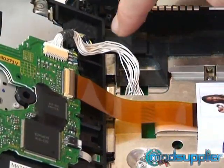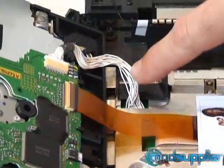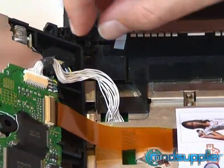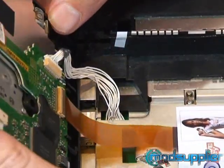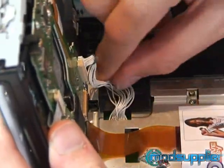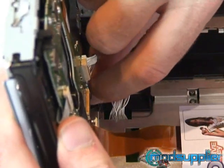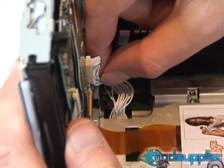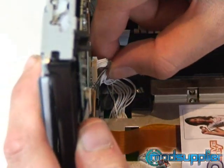It's sort of bowing on this angle. Note the power cable here — it kind of does a moon shape and fits underneath this bit of plastic here. When you're going to fold the drive back over, raise it up and just push the power cable in so that it fits underneath the housing here.